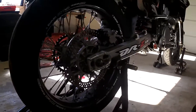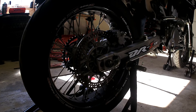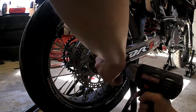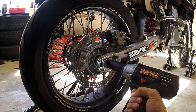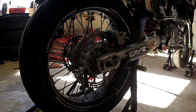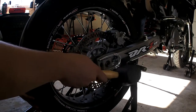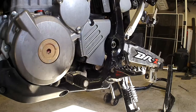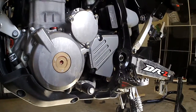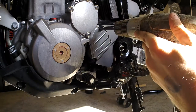The next step is going to be to remove the nut from the rear axle, pull the rear axle out, and slide the wheel off. On the SM, this nut's a 24mm. I'm not sure about the size on the S and E model. Just slide the axle out here. Our next step on the bike is to take this front cover off and get the front sprocket off — this is just two 8mm bolts.